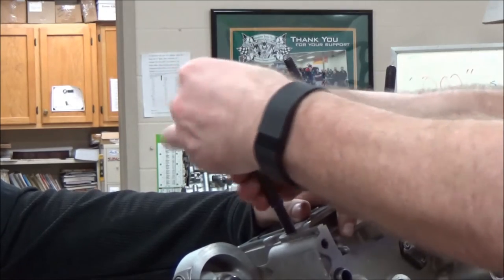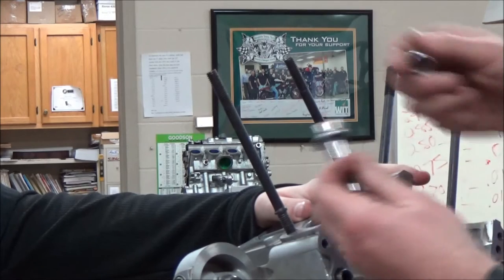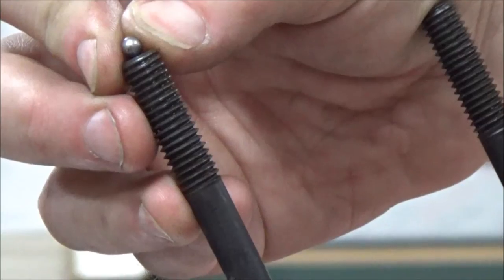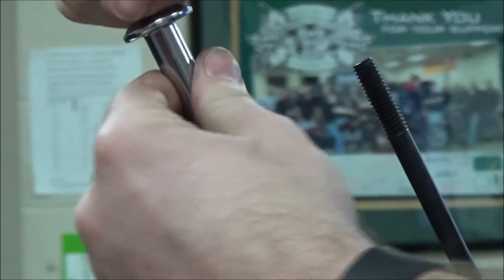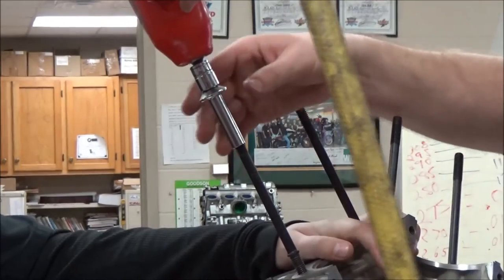The service manager says we can go ahead. Let's see how well this goes in by hand. To speed it up a little bit, I'm going to use my 12-point socket. I'm using a factory head bolt, and what they tell us to do is put a ball on there like so. Here's a close-up of that steel ball I'm referencing — it's simply a ball bearing. Put that steel ball with the head bolt on there, and you can see it has bottomed out.